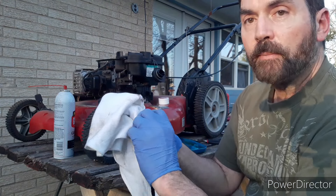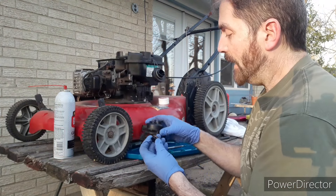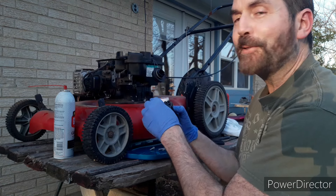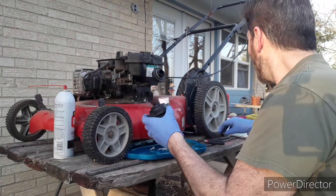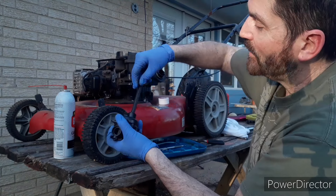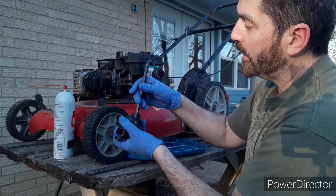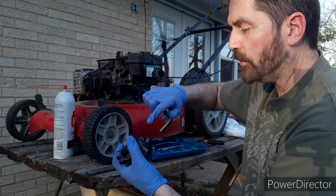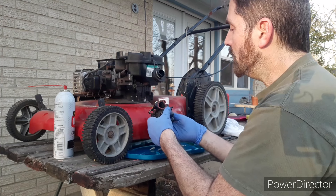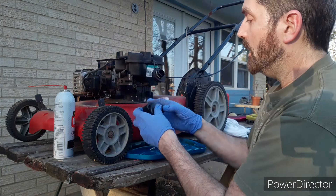Clean the O-ring on your plug before you reassemble this thing. I've actually forgotten to put this back on one time — went to put fuel in my carburetor and it just all drained out of there. It doesn't go on hard. It just goes on and does a really small turn to lock it in place. Don't crank it down, don't do a full turn. That is it — just need to put our bolts back on here.